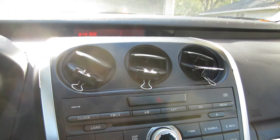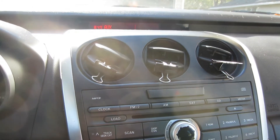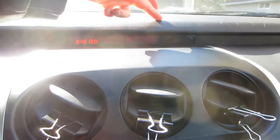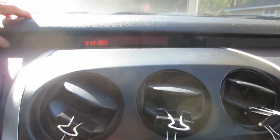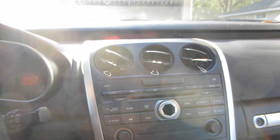I know from experience it's not going to stay that way — it's done this several times and it will happen again. What I suspect is happening is we might have some cold solder joints or a poor connection in the circuit board up here, because this is an LED-powered light. So we're going to go ahead and pull it apart and check that out. Unfortunately we've got to pull a lot of this apart, so big thanks Mazda — but let's get on with it.